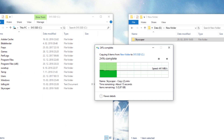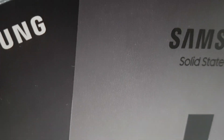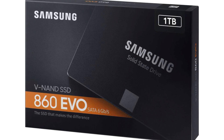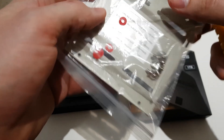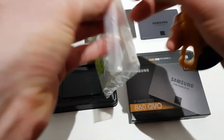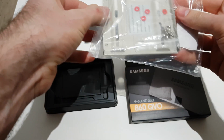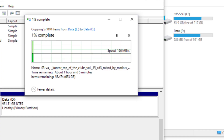But there is a catch here. This drive is incredibly close to the 3-bit 860 EVO, but it has one very important limit. When you copy files bigger than 40 GB, the rated write performance will slow down, so the average write speed could be less than 250 MB per second when copying 100 GB of data. That's because it has a limited write cache.